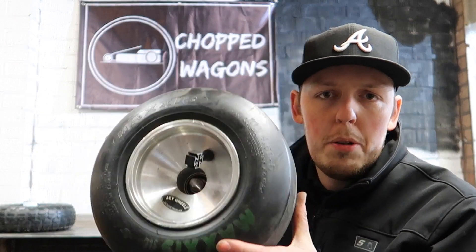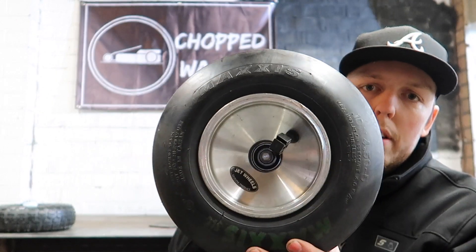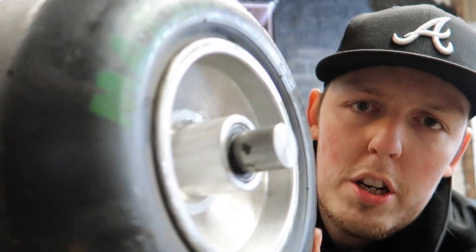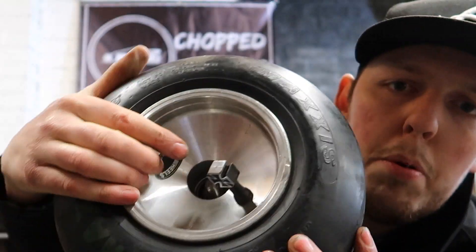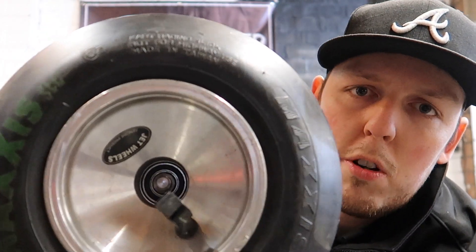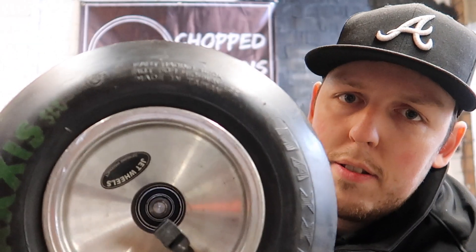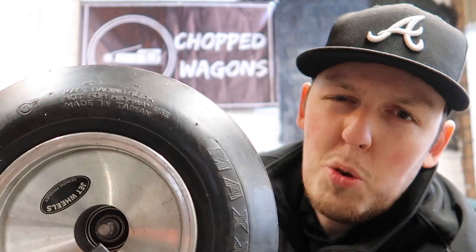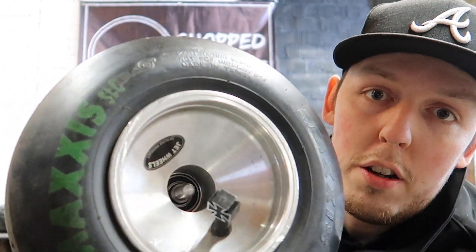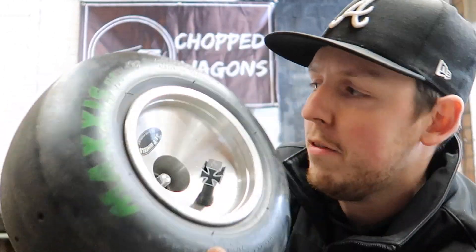Front go-cart wheels require a 17mm bearing — so that's our axle, like I showed you earlier, pushed in through. All you have to do, put an M12 nut on there, nice and secure. You can get these front wheels which require a hub — it's an extra 25 quid a side, so an extra 50 quid added to your build if you've got go-cart wheels that require a hub on the front.